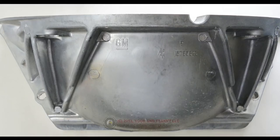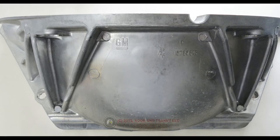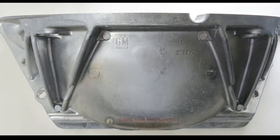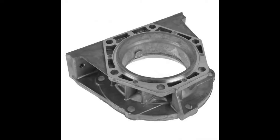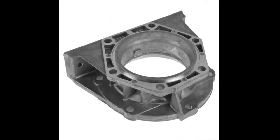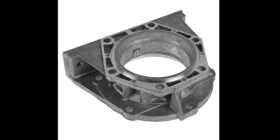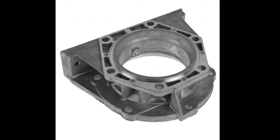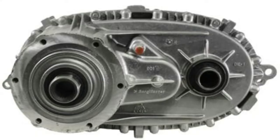Then you'll also realize you don't have the bolts to bolt that thing on. So while you're there, if you're getting one from a private seller, get the cover. Another piece that falls into that category is the rear adapter. The reason you want this particular piece is it won't fit on a 4L60E, and the 4L60E adapter won't fit on the 4L80E. So this adapter — get it.